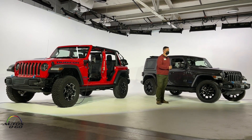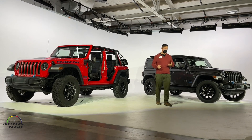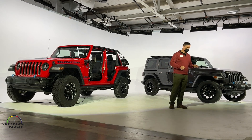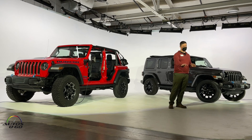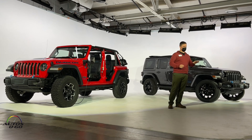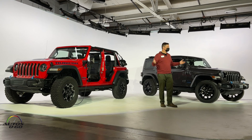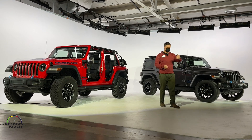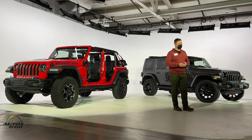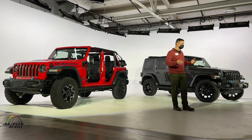One other feature to call your attention to is Max Regen. There's a button near the volume knob in the radio that turns on this Max Regen feature — it has a blue icon. What it does is remap the accelerator pedal, so at zero or low accelerator pedal positions, the car will actually apply the regen brakes and slow the car down. This allows the driver to keep their foot on one single pedal — a lot of companies call this one-pedal drive. It's pretty unusual in a plug-in hybrid, especially one with a step-gear transmission like this.